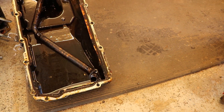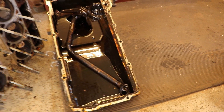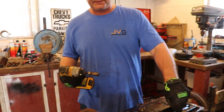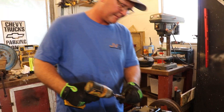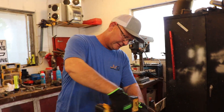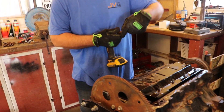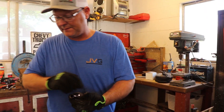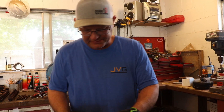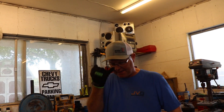A little fun fact: if you have a truck with an LS and you start to hear lifter tick, it is probably the o-ring off of the oil pickup tube. My dad's truck had the same issue — sounding like a sewing machine going down the road. He went on a forum, saw that was the issue, and tried it. The other thing that can possibly cause it is a little piece they call the wishbone or dog bone — it's in the back of the block and it's an oil bypass. If the o-rings on that crack or break, it can cause excess oil to bypass and you'll lose oil pressure to your cam and lifters.